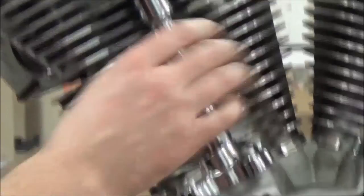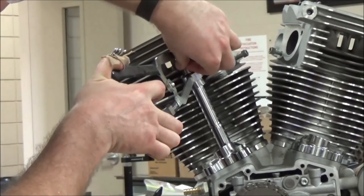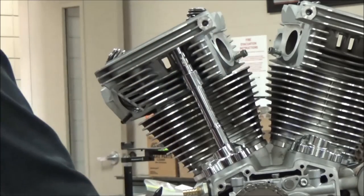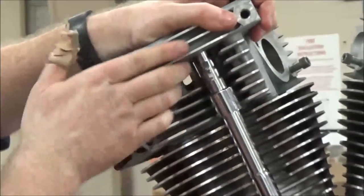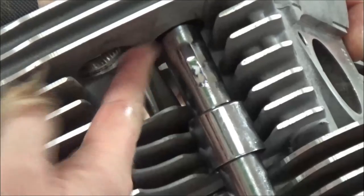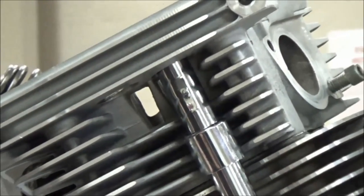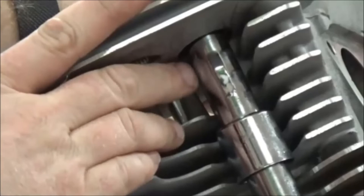I'll take my install tool — let me tip it back so the camera can see. This clip serves two functions: number one, it holds the inner tube up into the cylinder head, and it also acts as a decorative piece covering up that inner tube and beautifying it with the chrome. Notice how the clip is really nice and centered along with the push rod tube — you want that for cosmetic value. Think about those little details and the pride you put into your work. It keeps the customer happy, looks cosmetically pleasing, and makes Harley proud — or whatever engine you're working on.